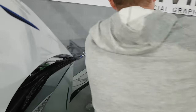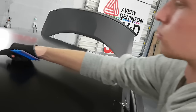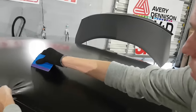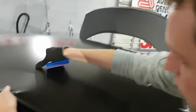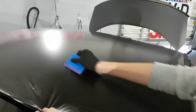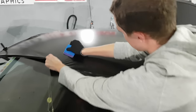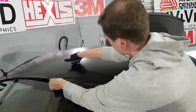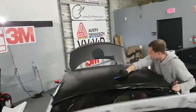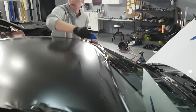Andrew's got a bit of a bubble here — just lift it and push down hard on it. It's gone. You just push down hard on that wrinkle, add a little tension to the film, and it's gone. This is a super easy film to work with — it's probably my favorite, it will always be my favorite. We get a lot of requests for Vivid so we use a lot of Vivid, and we like using Vivid as well. It offers a different finish and has its own technical components as far as the way it works.